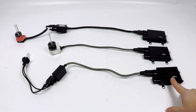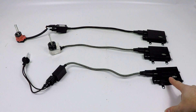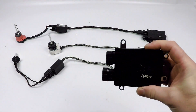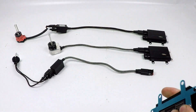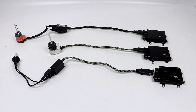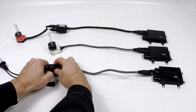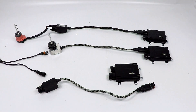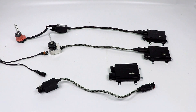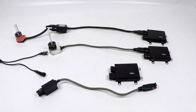I have three setups here. The first is your standard rebase setup — you've got a Morimoto ballast, an igniter, and the actual bulb itself. This is the Morimoto XB 35-watt ballast, the newest generation. The computer — we call this the ballast computer — is separate from the igniter. These are separate pieces. What's good about it is that if one of them fails, you don't have to replace both. Majority of aftermarket ballasts are going to be set up differently — it's all going to be inside one larger box, with the igniter built in.